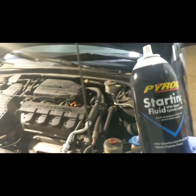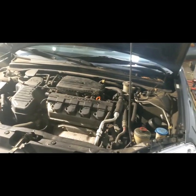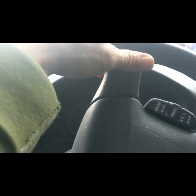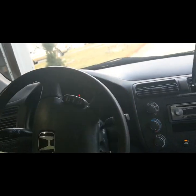I'm going to go ahead and buy a new pump. I was able to start it with starting fluid, so now I'm going to park it where I need it so I can put the new fuel pump in. The fuel pump is not priming — once the car is running it worked enough to keep it running, but it will not prime enough gas to start the car.